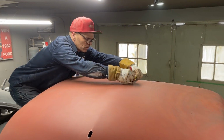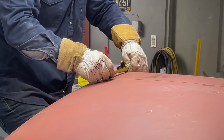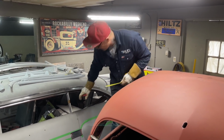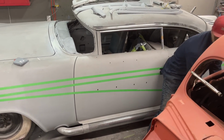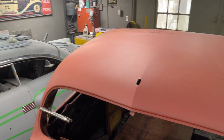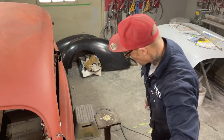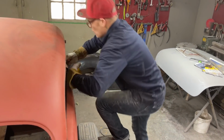I'm just going to run my finger along this and do 5.5. Just like so. 5.5, 5.5. We'll cut it off with the plasma cutter. We'll butt weld it back together, but we'll probably have to zip cut it. And if we have to zip that off to get that window shape looking better, we've only got one spot of weld on it, so we should be fine. And that's basically why I put one spot of weld on it, because I didn't know for sure.